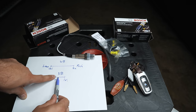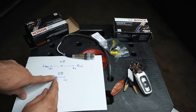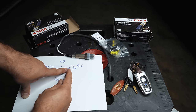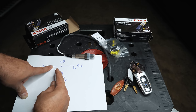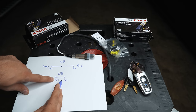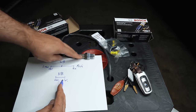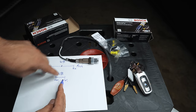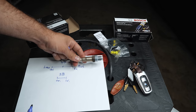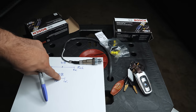What the bad sensor was doing was shifting the zero point — the midpoint — for the wide-band sensor, which is calibrated off the narrow band. If the ECU thought everything was fine but was running rich, it could actually have been lean, causing misfires in cylinder six or wherever. These sensors can't be neglected. They're not just there to see if the post-cats are working; they calibrate the primaries and are critical for overall fuel economy — just like pressing tare on a scale. That's what the narrow band does when you start the car: it's your reference point that calibrates the wide bands.